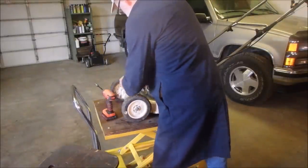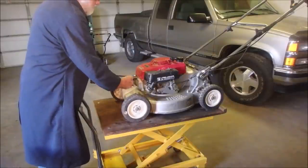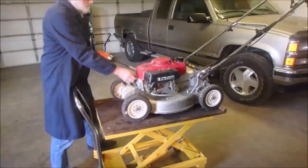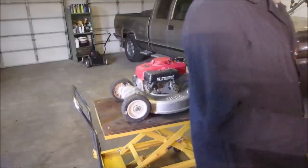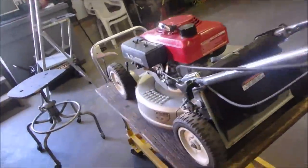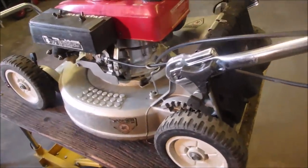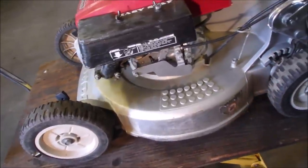We don't need this test plug in here anymore. Now, because I've done so many of these lawn mowers this year, I know exactly what to do and what not to do as far as taking them apart. This is the one you can run on the stand because this is the independent blade clutch. So you push this down like that and then the blade turns. These are nice to work on because once you release the blade clutch, you can run the engine without the blade turning — but you can't fully trust it, because if there's something sticking, it'll turn. But it's a little safer.